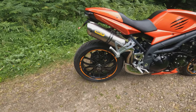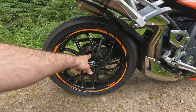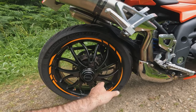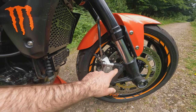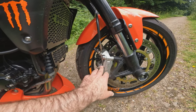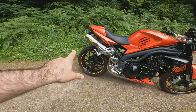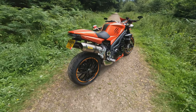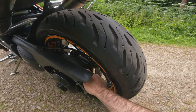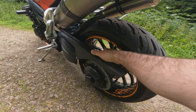The additional rim tape and decals on the wheels are an optional extra. You can tell the later 1050 models because they have these curved spoke wheels rather than the three-spoke originals. From 2005 to 2007 versus 2007 up to 2010 — they changed to this design. They also came with these Brembo four-pot calipers from 2007 to 2010, coupled to these 320mm floating discs. The early ones had Nissin calipers, which suffered a little bit with the piston seizing up and binding. So you can tell the slightly later 1050 from 2007 to 2010 by the Brembos and the curved spoke rear wheel. Another feature of the Speed Triple — single-sided swing arm, really, really nice feature. You do have to keep an eye on the eccentric adjusters — if they're not taken apart and cleaned quite regularly, when you go to adjust your chain tension you'll find the eccentric adjuster is seized up.